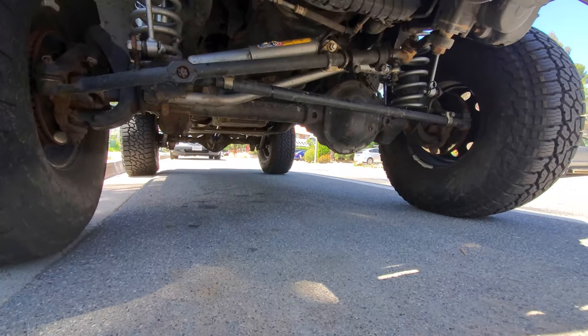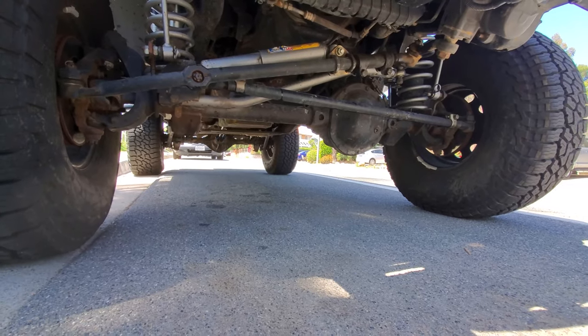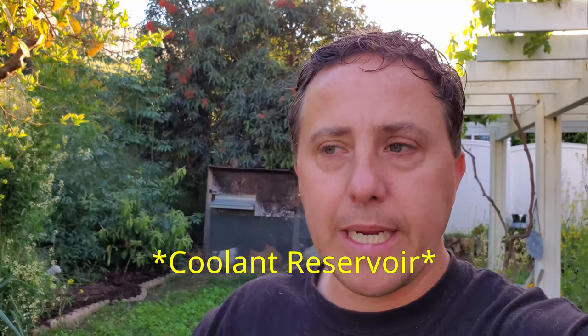It is running and there are no leaks right now — unlike before. I opened up the hood and the reservoir is full, so it looks like the repairs are effective and complete. I've driven the Jeep with the new water pump for about a day, went out to the desert and came back. When I first got it running, it seemed like it was running a little higher temperature than before, but as soon as I filled the water reservoir and it sucked the coolant back in — dropping from full down to the add line — it seems like it's running about normal.